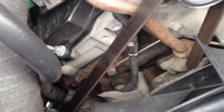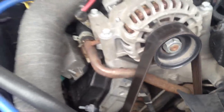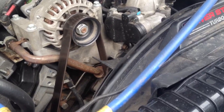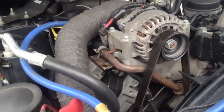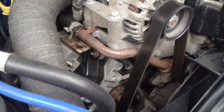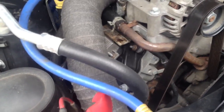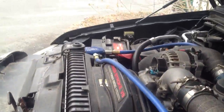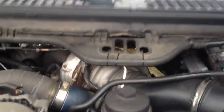We've got the banjo bolts down there too — I'm going to replace those. I'm going to start draining the fluids. I recommend doing everything in accordance with your local rules. Take your vehicle to an authorized dealer or AC mechanic to have them depressurize your AC system — they'll do that for free as part of federal guidelines. We're going to remove a lot of stuff: take apart the condenser, compressor cables and wires, remove the AC evaporator, get the shroud off, disconnect the batteries, and drain and properly dispose of the coolant.